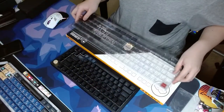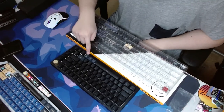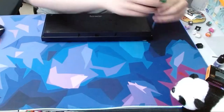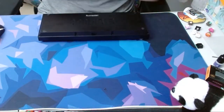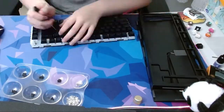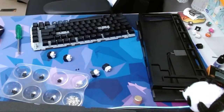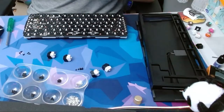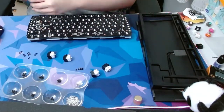I also learnt my lesson on why you should always check to make sure the keycap set is compatible with the layout before purchasing. Anyways, I wasn't very happy with the end result as the typing experience felt extremely stiff and the sound wasn't as nice as I would have liked it to be. I tried out a couple mods which included removing the foam, removing the standoffs, and removing the screws that held the plate and PCB together.